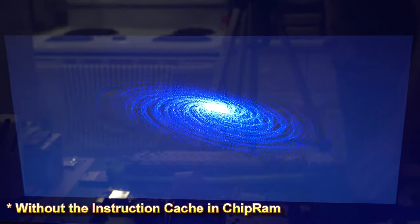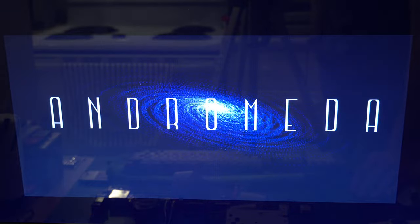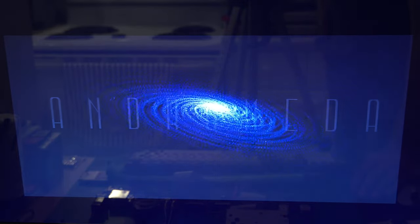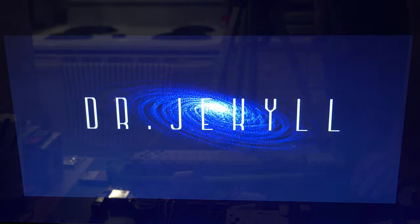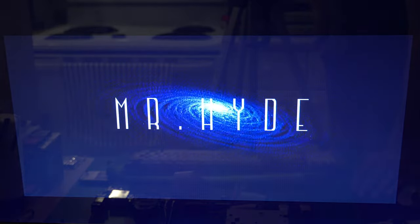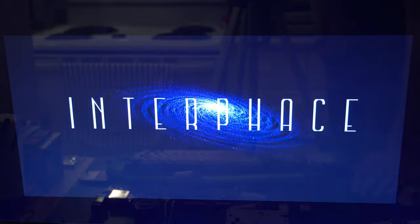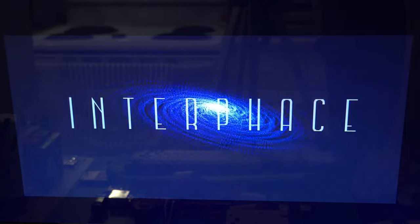Now this is without the instruction cache. This is the whole reason why the Wirelink thing was made, to improve the compatibility with demos. This text here should not be flickering like that at all. It looks really choppy as well. It's not as fluid moving as it should be. So that's the first sign that something is not right with this demo, but it still works. But I think what's happening is the timing is getting messed up a bit, so it's causing issues with the code.